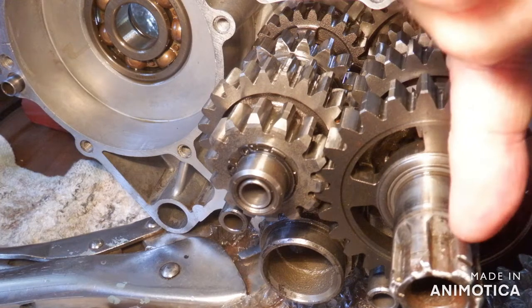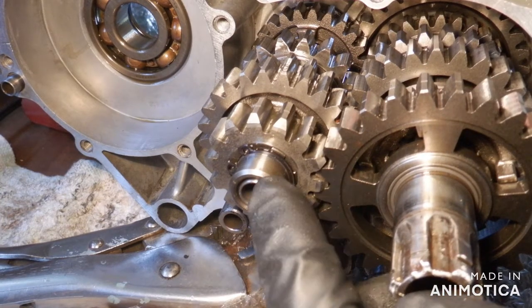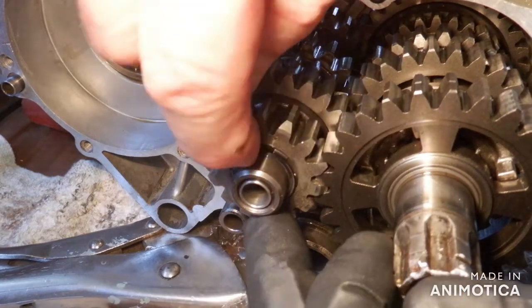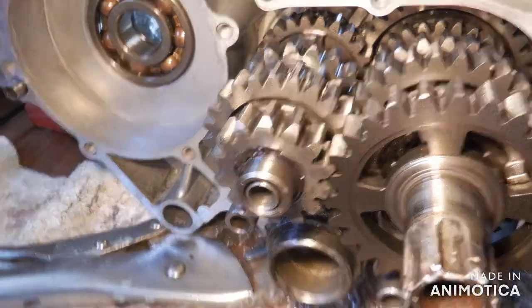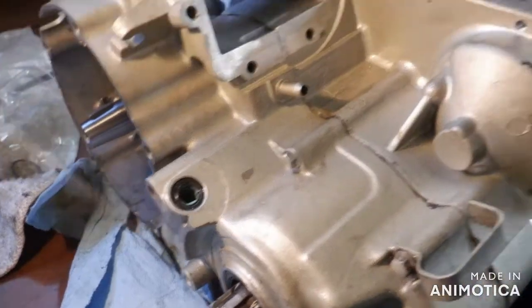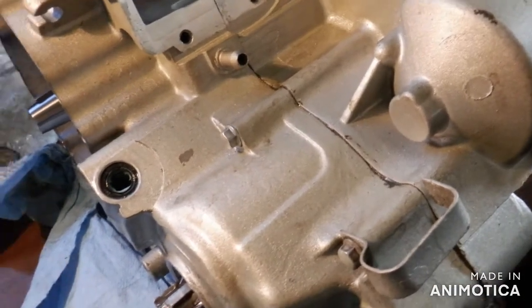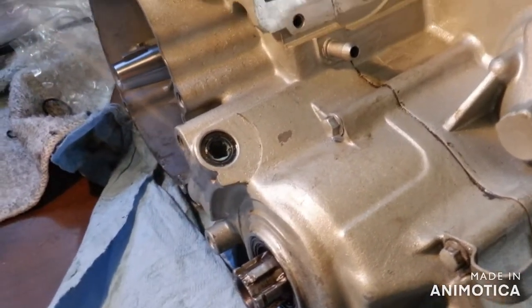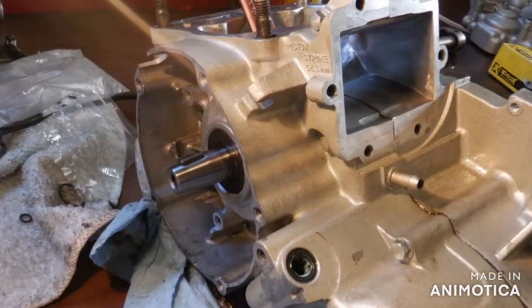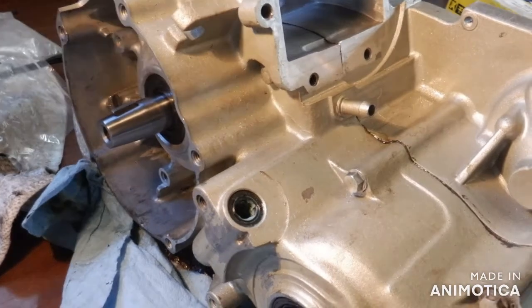You've got a washer on the inside of this lay shaft — not here. If you've moved or removed them, replace them. Well, it went together fairly easy once you put the transmission in the right side of the engine case. So there's your lesson in transmission installation.